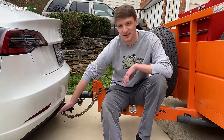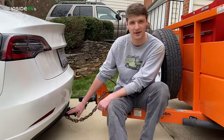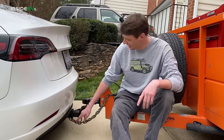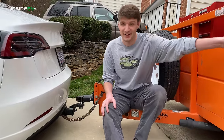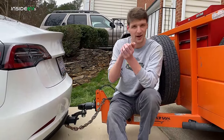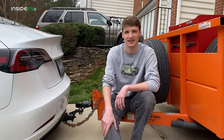This is a recent US Model 3, so they have the little cutout panel on the bottom where you can open it up — that's where a hitch would be if you were in Europe. It's not available in the U.S., so we bought the Eco Hitch from torquilift.com or eTrailer.com. We also had to get a wiring harness, so we got a universal one actually meant for the BMW i3. It clamps sensors around the wire without cutting into it and relays the brake and turn signal through to the trailer. All parts will be linked in the description.